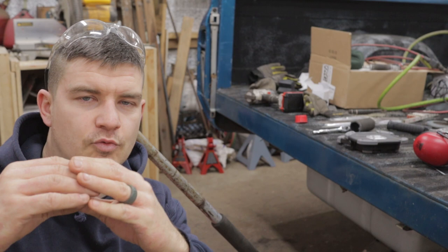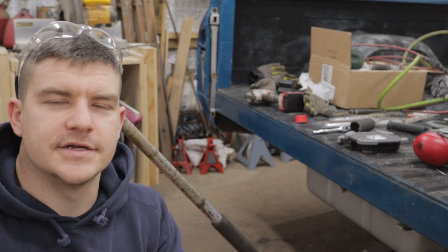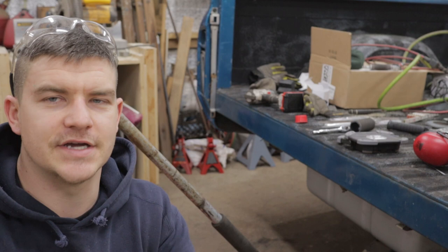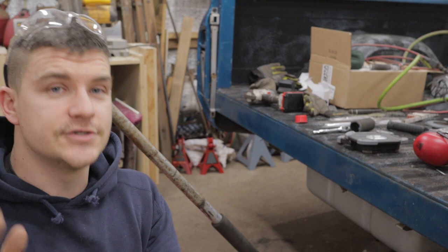When it gets warm out, that tank's gonna expand too, and the top of the tank's gonna push up. So we wanna make sure we have plenty of clearance, but I also need to make sure there's plenty of room for the hose clamp on that neck. Stuff like this used to really kick me in the private parts, but after building so many vehicles, you kinda just roll with the punches and stuff like this won't slow you down. Before I pull the tank back out though, I'm gonna check the height of that rubber tube so we can cut that at the same time. So we only have to put this back in once.